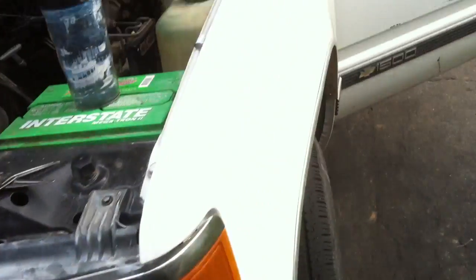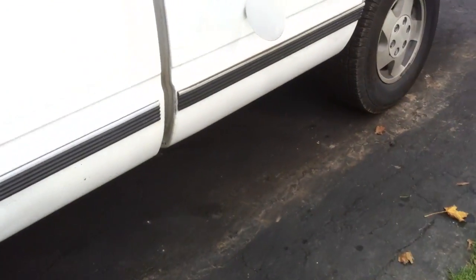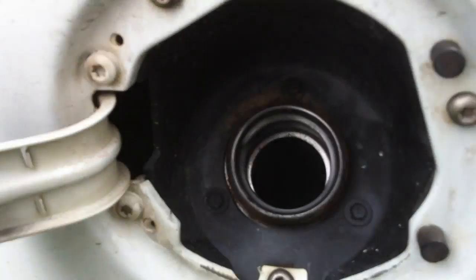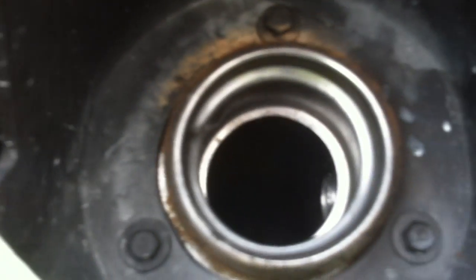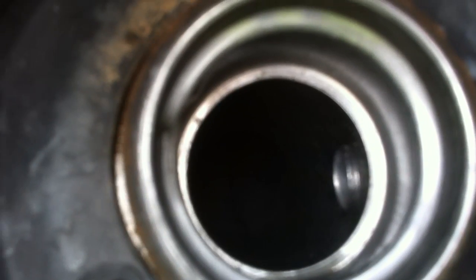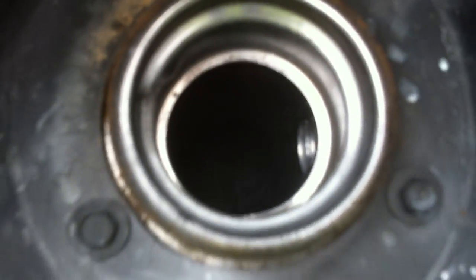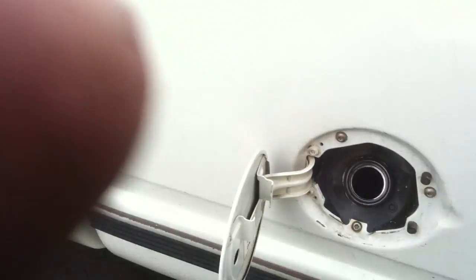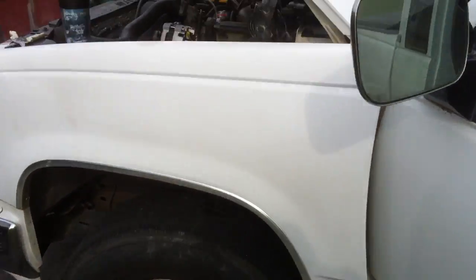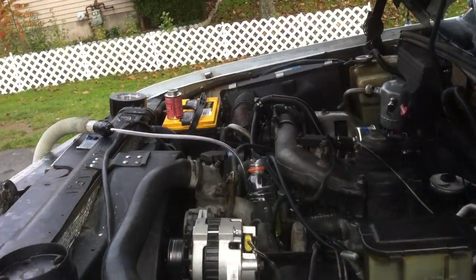Walk back here for a minute. The gas cap is off, of course. And if you have a clear line, you should be able to hear that bubbling in there — a little gurgling. Anyway, I've been getting some air in my fuel system and have to be constantly venting my T-valve there.